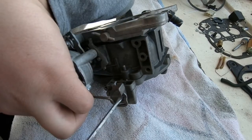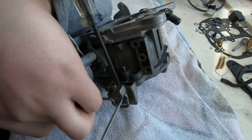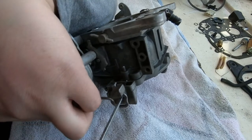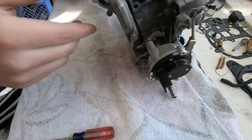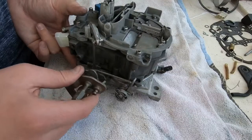And now we're turning this guy from unloaded to 7/8 of a turn, which is exactly what the rebuild instructions said to do, tightening the set screw to lock in that 7/8 turn worth of tension on the spring. And basically, that's about it. We're working a few components here, just making sure everything works smoothly. And bingo, we're done.